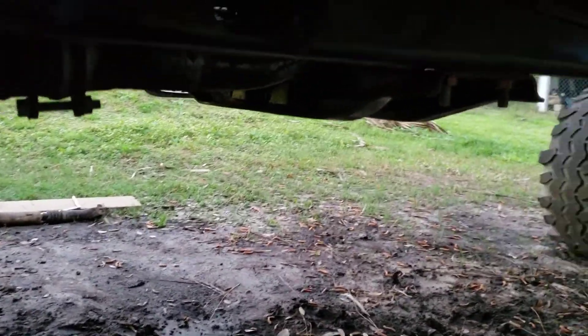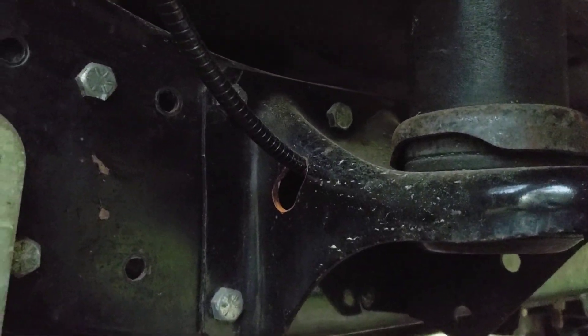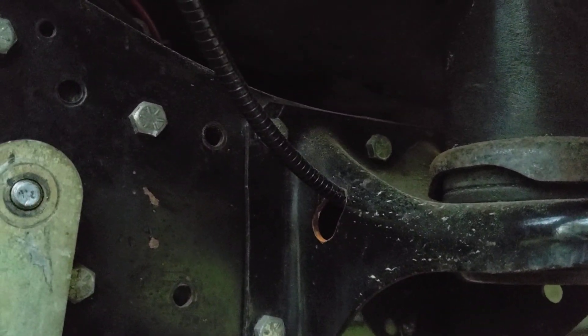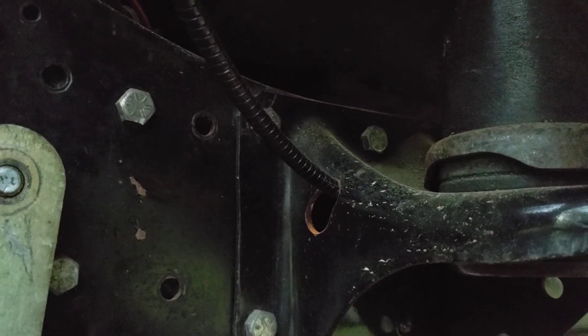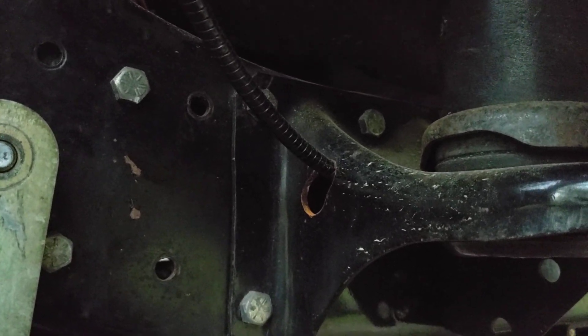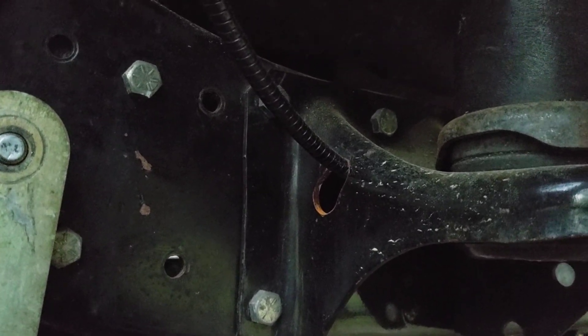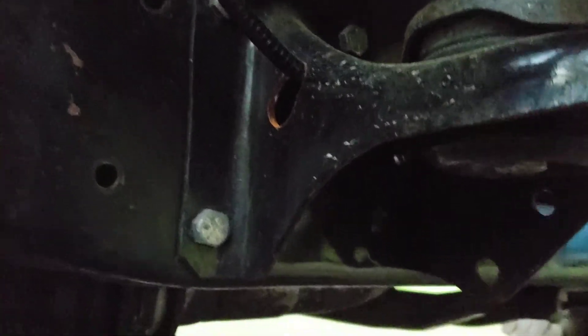For the body lift, I ended up drilling a hole and elongating it so that the parking brake cable from the cab could pass through the mount. I don't see this cracking at all — that's why I kept the holes rounded.